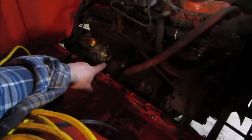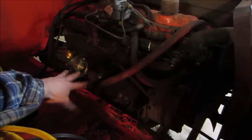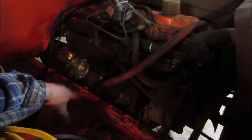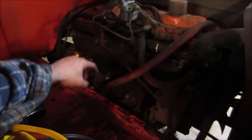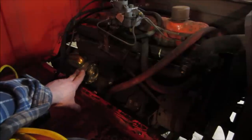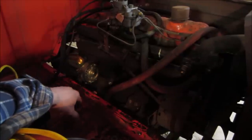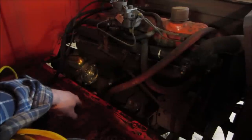First, I re-loosened the collar. We're kind of questioning whether there's a seal between the manifold and the pipe. I've looked it up, and it appears both ways. Kind of weird. Anyhow, I loosened it up and wheeled it around. There is a shoulder down about 4 inches that clamps onto it and supports the pipe. Reset it, tightened it. Nothing leaks at all. For now, I'm going to leave it alone. If I have a problem with it in the future, I am going to get a donut of sorts to go in there. The one that we had was metal from the original one. Anyway, that's where that is. All that seems to be fine.